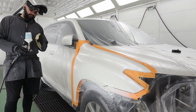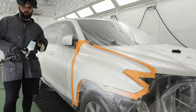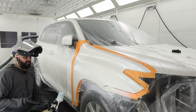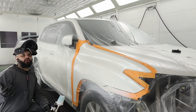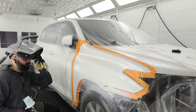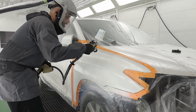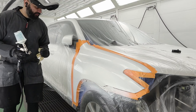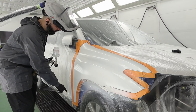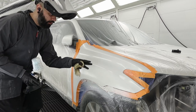Now we're going to re-wet bed it. I'll do the exact same thing — go through that area and dehydrate it, and then we'll get onto our pearl coat. The reason I'm re-wet bedding this is: first, it allows me to see where my pearl is actually at; and second, it gives the pearl something to land in so it doesn't stand up at the end of your blends. As you probably noticed, I actually opted to just avoid the area where I sprayed my white ground coat, so now all the surrounding area where I need to get my pearl layer down is coated. I'll go ahead and grab my pearl and immediately spray it into this.